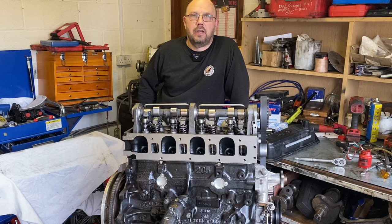What you just saw wasn't the most bizarre clutch ever. It's one of the drive plates that we use to connect the engines to the dyno. All I was doing there was double checking it for runout. Normally they go on okay, but I did do one V8 Rover. We had a few thou too much runout on it, and yeah, the engine ran, but oh dear, it shook and wobbled and vibrated, and I had to pull the engine back off the dyno to double check. So it's easier just to make sure they run true before we fit them.